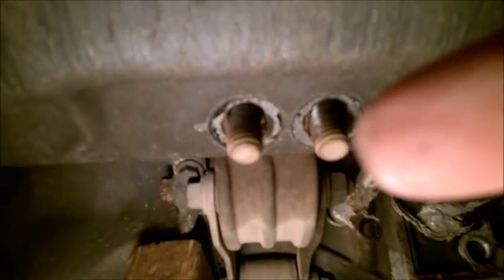And also, being under the car, we are going to detach this, that's a torque mount. So just undo this, I think it's 17 or 18 with a half inch bar, half inch ratchet. Undo these two guys, they are pretty stiff in there. It's important.